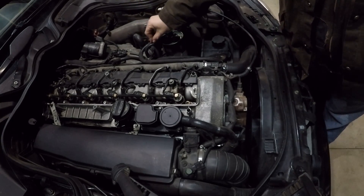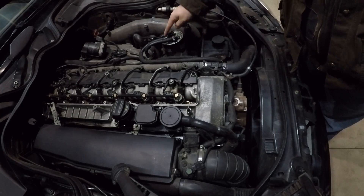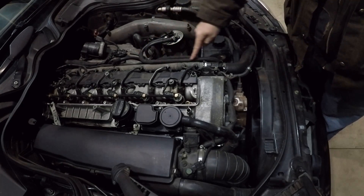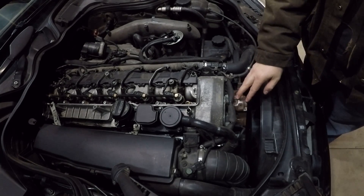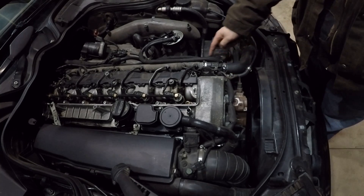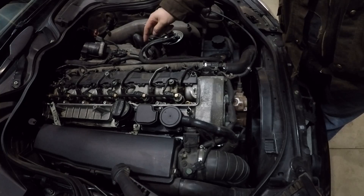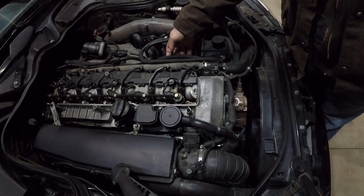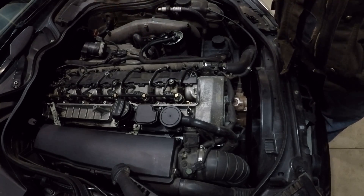So when it reaches this point, there's 120 psi pressure behind it. It then goes through the filter and then goes this way to the inlet side of the fuel pump. The fuel pump return line is right below here and then goes right back into here. The return line actually has two fittings on it — one for a dedicated return line from the pump, and one dedicated return line for the rail.